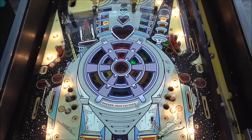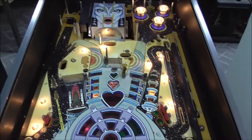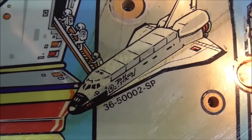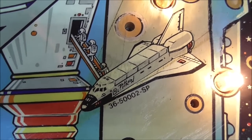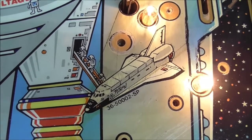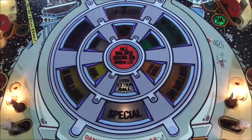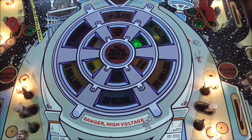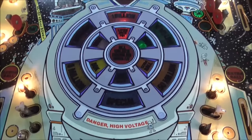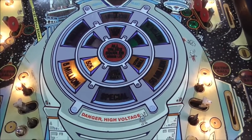So, I'm just going to hit every area that's got some stuff going on and see if we can get it cleaner. If that wasn't under the clear, we could get that a lot cleaner, I think. And so I may be able to carefully cut through the clear, since it's probably not all that thick, and see if I can clean it up a little bit. On this main middle piece is a decal, so I don't want to go too crazy on that. It looks nice and clean anyways. We're going to clear over it like they already have once.